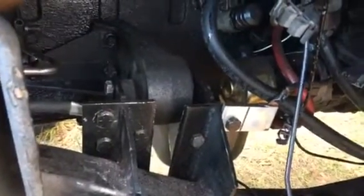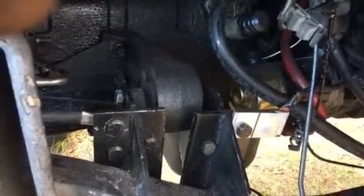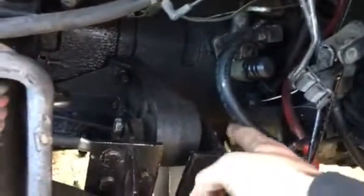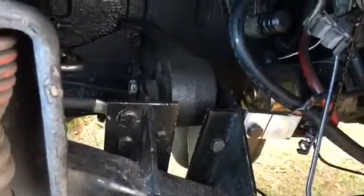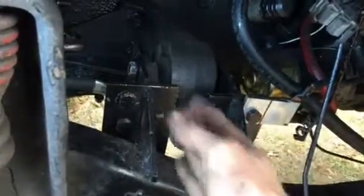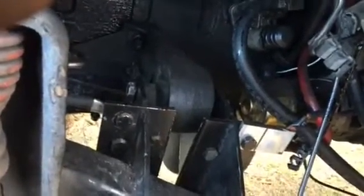I got the motor mounts in. I'm not very happy with them just because of what all happened. I built them, and the motor was sitting in on its own. Went to take the motor out so I could finish welding it all in, and the transmission adapter plate was hitting, and there was no way for me to get the motor and transmission out without redoing these mounts. So I cut them in half, put 2 pieces of metal that I could bolt together, and welded them on each side. You know, take out the difference.